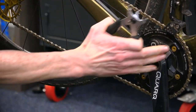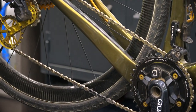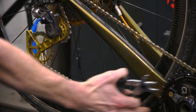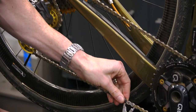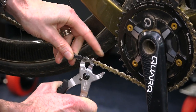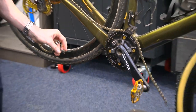I just get the master link. If you've got a double chain ring, you want the small chain ring and smallest cog so that there's not a lot of chain tension. If you pop the link open and you've got a lot of tension in the chain, the bottom span can fling up, which is a bit exciting. You just put the tool on either side of the link, squeeze the link, and the link will pop open. Now my chain is ready to take off.